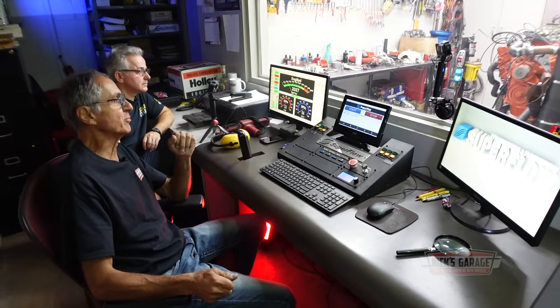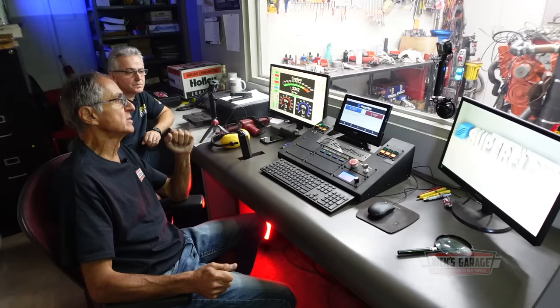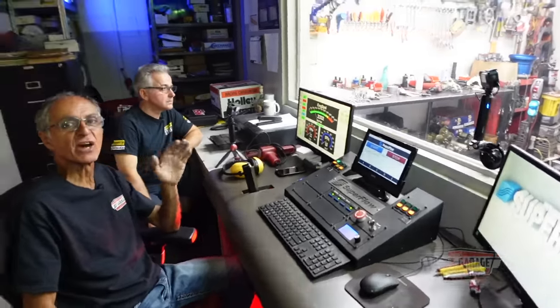I wanted to keep it simple. It's a cruising car, it's a convertible. I wanted to put on some cast iron heads, make a good valve job, with brand new Manley valves, and of course we brought up the compression, and we had the heads ported out. The flow was almost 260 CFM at 500 lift. That's the flow on the cylinder head, so let's see what it does.